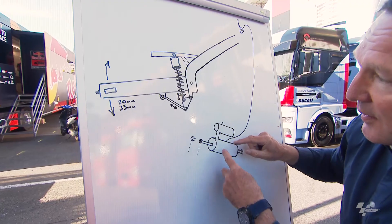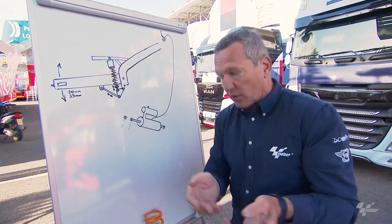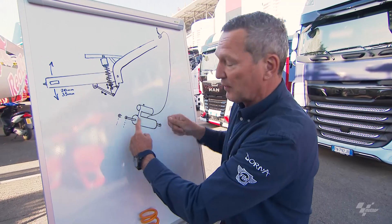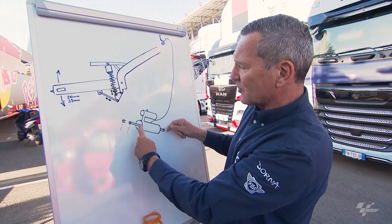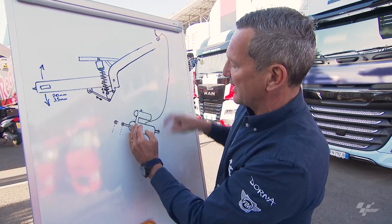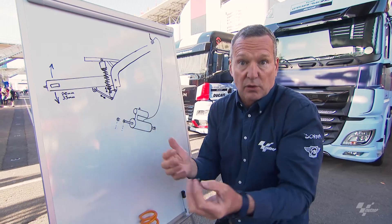It's very similar technology to a rear shock — smaller, but the same thing: gas pressure, oil, really similar. That rod can slide in and out much like a rear shock, which lengthens the rod and just allows the rear to move up. But it must do it in a controlled way — they don't want it to just fall. It's adjustable like a rear shock: same technology, gas and oil under pressure, adjustable both ways like compression and rebound. The difference from a rear shock is that a rear shock stays long and compresses, while this stays short, and when they pull the lever it can lengthen. The lengthening is really done by the weight and force under acceleration — clever engineers using force that's already there.